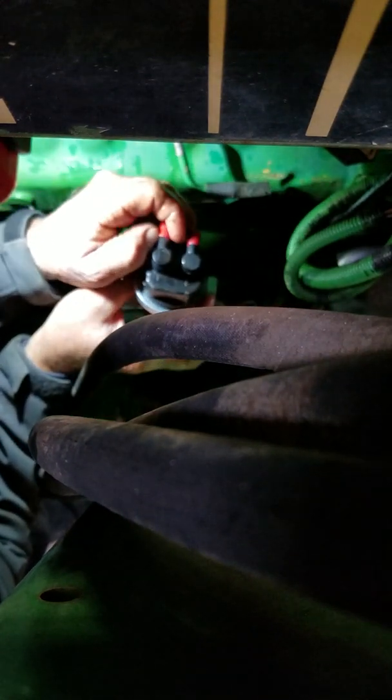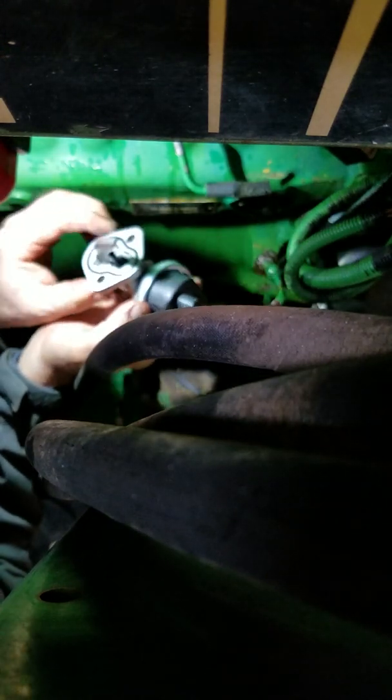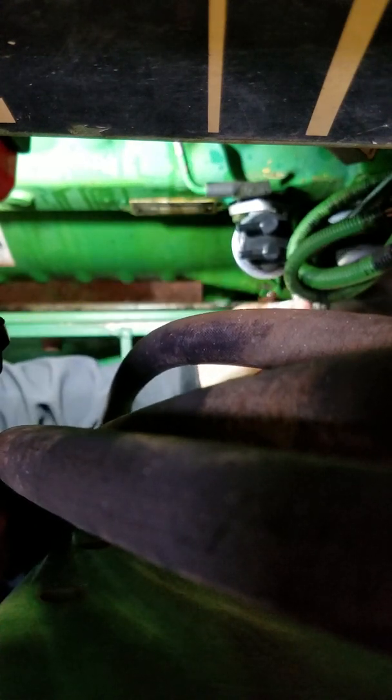This new pump — don't forget to take these little plastic protector caps off and throw them away. This pump has a seal o-ring here; put it in there, make sure it's in there, and install it. Make sure this lever is up when you put it in, and just basically bolt it on — hand tighten that bolt.